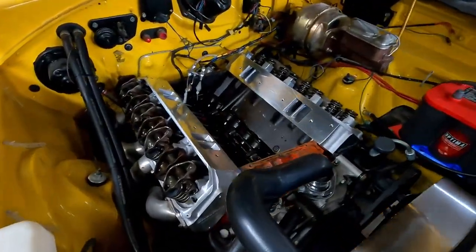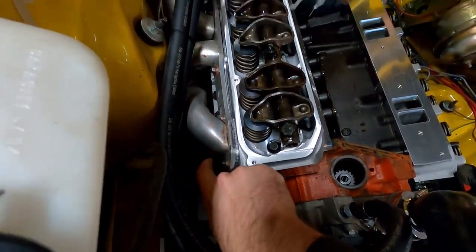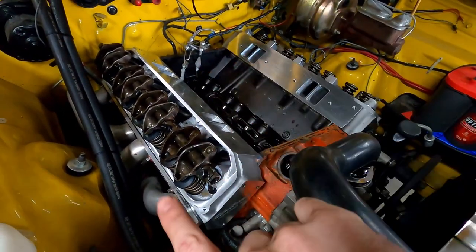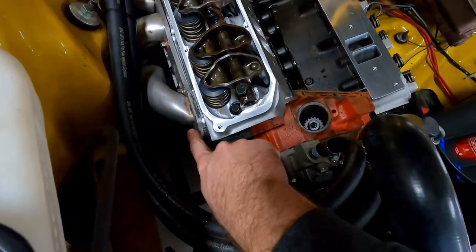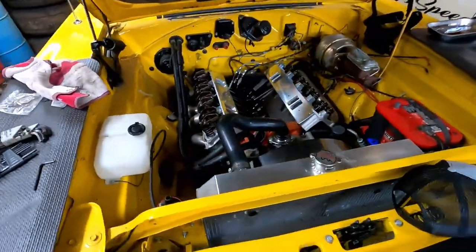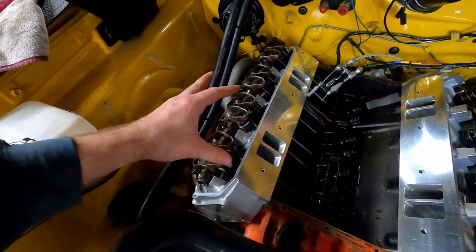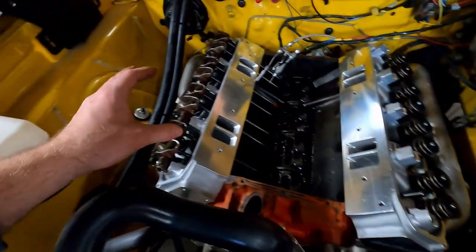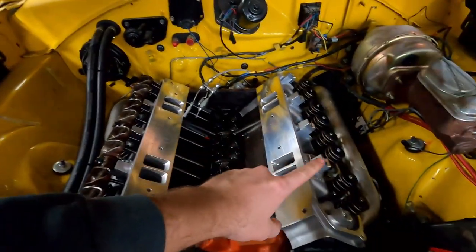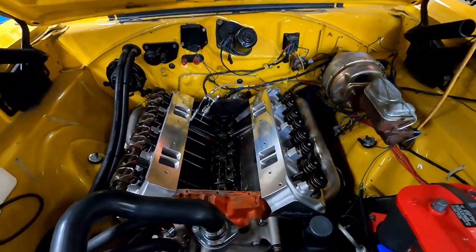I was reading up on the instructions and found out these are actually blind holes for the exhaust manifolds on the Edelbrock cylinder heads. The stock heads go into the water jacket, but the Edelbrock heads do not, so the RTV was unnecessary. I did it anyway because I didn't know that, and it's not going to hurt anything. Working on getting the rocker shaft assembly on this side, and then I'll show you how to do it on the other side - I'm teaching myself on this side. It comes with these studs and I'll show you how those work before I put it together.